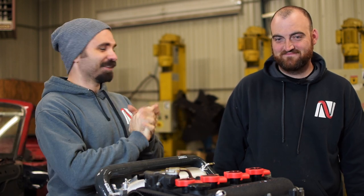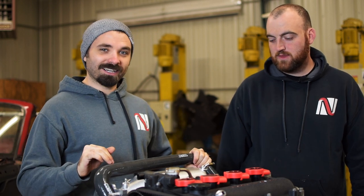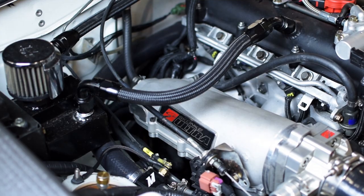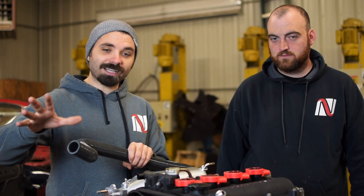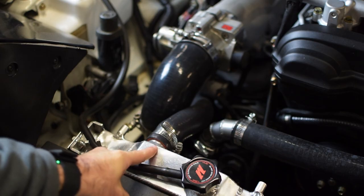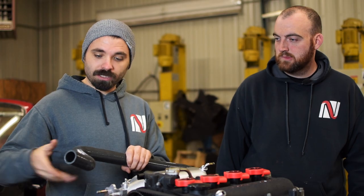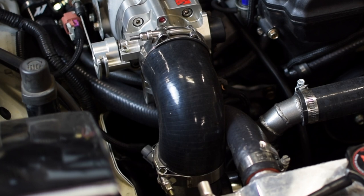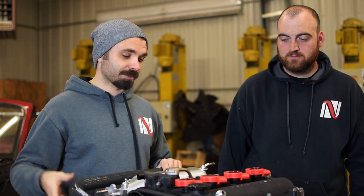There are a couple things I really like about this kit. I think this hose is so key. On my car, we're running a different coolant reroute from Super Miata — it's just one large hose that kind of snakes its way around, and it becomes a problem up front. It's designed with their radiator, where the coolant neck is much farther out — like four to five inches off to the side, so it's a straight shot in. Whereas with everyone else's radiator, there's this little offset that creates a weird junction in my engine bay. So I'm half tempted to just buy the hose, which Moss has for sale on their website separately.